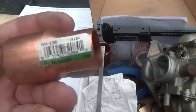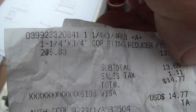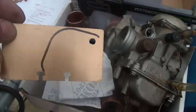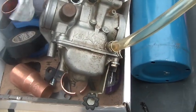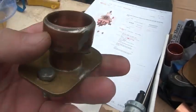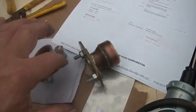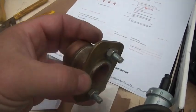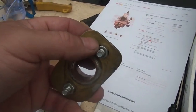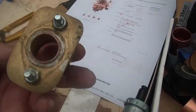What I did is take a plumbing piece — officially a one-and-a-quarter to three-quarter adapter, about $7 each. Then I took a small piece of brass, about $2, from PNT Surplus — you can also get them on eBay. Bill Stanton sent me one he made: he started with a piece of round stock, turned down the end to 38mm, left the other side bigger, drilled holes, and tapped them out with inserts so you could bolt the carb right to it. This is the first one I built and it's functional.